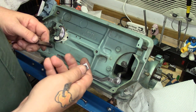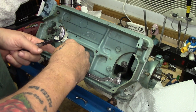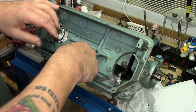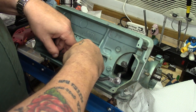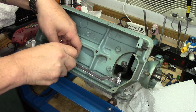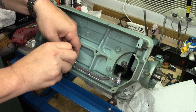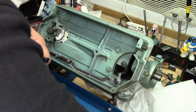Here's some more interesting stuff. We have this ramp piece here that was kind of crudded up. This rides on top of this bar here. We're going to put the ramp in this position so it's inside, and that's what's going to raise and lower the feed dogs. We're going to get the rack in, put both of the screws lightly in place, then take the ramp and put it on to get it lined up, start the screws by hand, and then go in with a real screwdriver and tighten them up. You can do this before it gets attached to the vertical feed, but what fun would that be? You've got to make it a challenge to get to the parts — that way you appreciate it more when you're done.